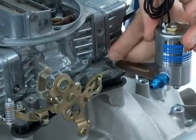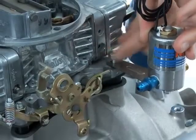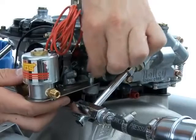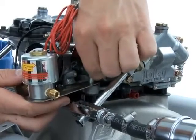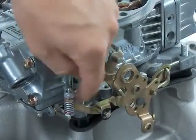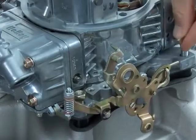In many cases, 1 or 2 of the bolts that hold the discharge plate in place will also hold a solenoid mounting bracket. If you've decided on this mounting style for your solenoids and brackets, in a minute we'll start to place the solenoids. For the time being, you can place any mounting fasteners that are not dedicated to solenoids and snug them hand tight.